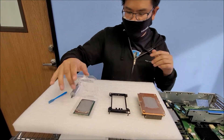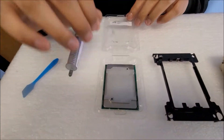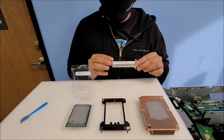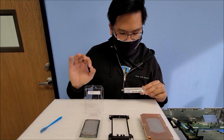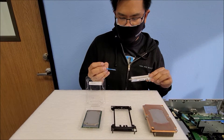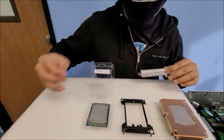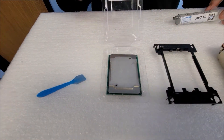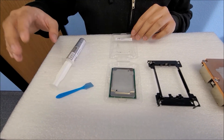To make this a little easier and shorter in time, I already have the thermal paste or liquid metal applied on top. So I'm using liquid metal — this is liquid metal or thermal grease. The pro of thermal grease is it's easy to apply and easy to spread. The con is it can get a little dirty. Use a thermal grease spreader because you want to spread it nice and evenly. You don't want too much where it spreads out beyond the CPU. Thermal paste might be a little tougher to spread compared to liquid metal, but still workable.